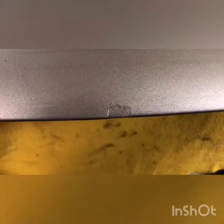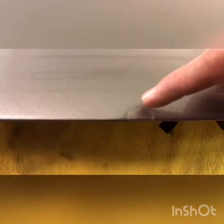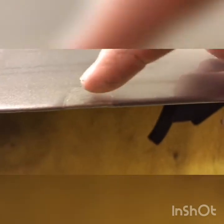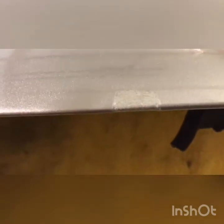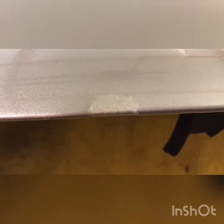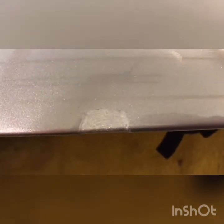When you're done with your final coat, apply the clear coat — it's just a protective coat on top of the paint to harden it up. You can see the different level of paint where we sandblasted is a lot lower than the original paint, so we'll keep doing more coats to build that up a little bit. We can get it pretty close, but it's not going to be perfect — but it'll be better than rust bubbles.